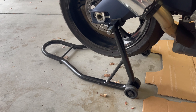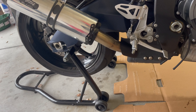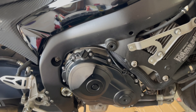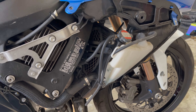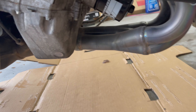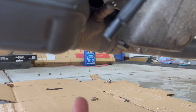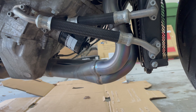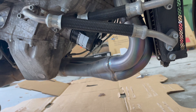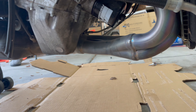You do not need to put your bike on the motorcycle stand. I have it so I might as well utilize it, but you can easily do this oil change laying on the kickstand. Pretty much after you're done removing the fairings — really, you don't have to go as in-depth as I did as far as taking them all off. But I have something else to do after this. When you come down here, you'll see the filter right here and this is your oil pan. That is your drain bolt right there. Depending on your bike, some bikes the headers will be in the way of getting the oil filter off, so sometimes you might have to drop those down. On my other bike I ran into that issue.